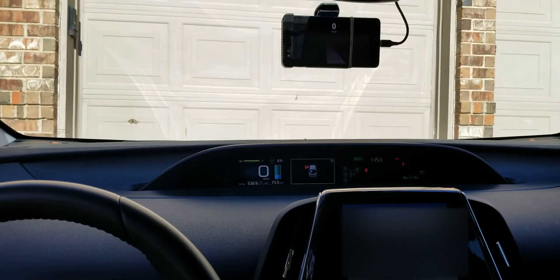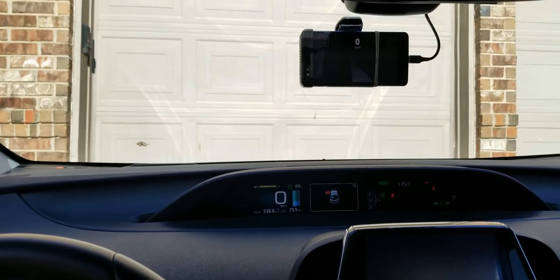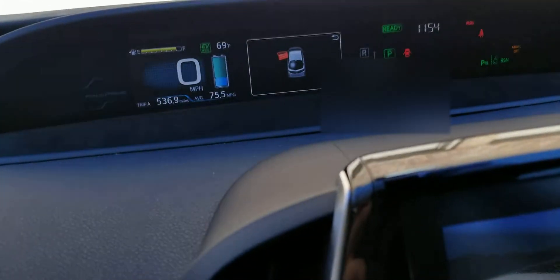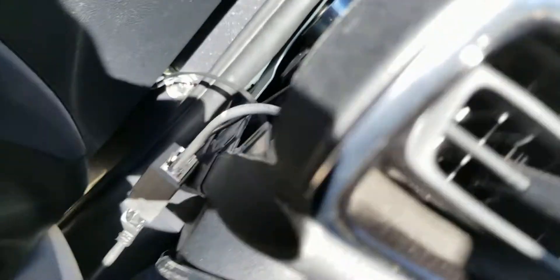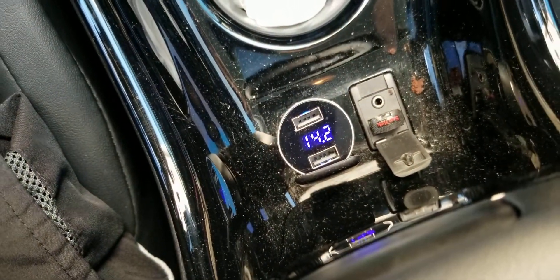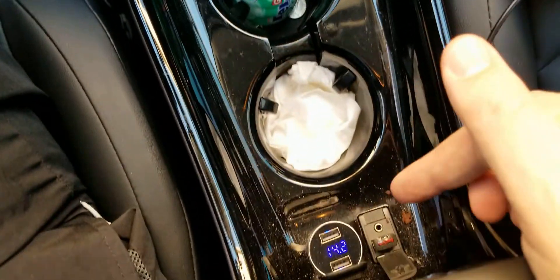Welcome to initial testing of the low voltage disconnect I've been working on. I literally just got some of the essential pieces in the mail. I've got the car turned on — this is in a Prius Prime — and you can see I've got a voltmeter in the ZSS. It's reading 14.1 to 14.2 volts. In the light socket it's also 14.2, so those pretty much agree. I've also got a voltmeter that I measured at various points and it agrees with all of this.